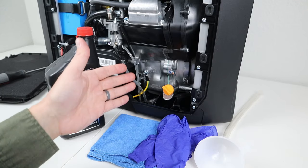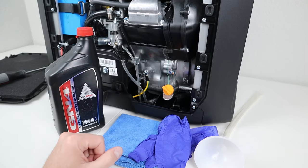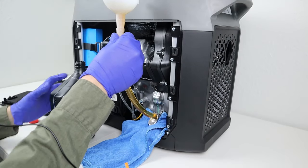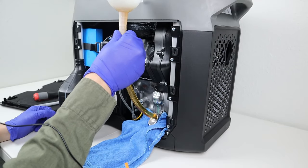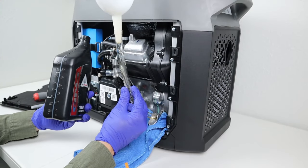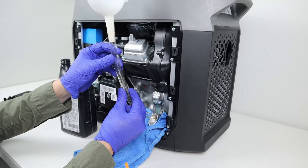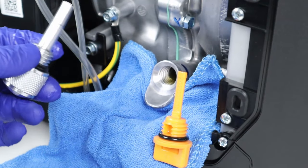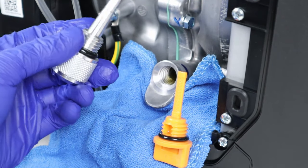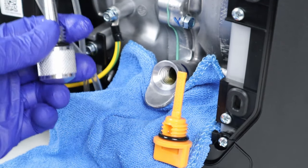The goal is not to make a huge mess — I have some gloves, an oil funnel, and a rag. After adding about 380 milliliters, I let it drip through and then put the oil cap back on. Once you finish topping it off, the oil should be sitting right at the rim, and then you can go ahead and put the dipstick cover back in.